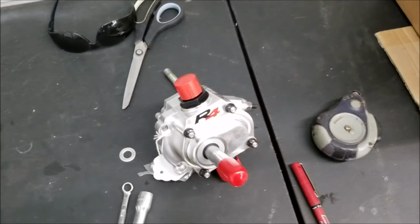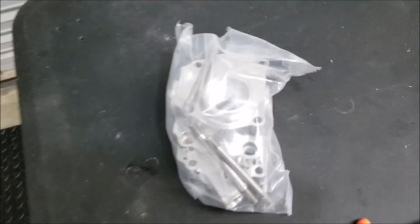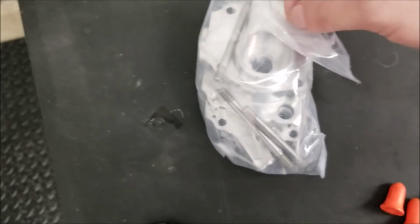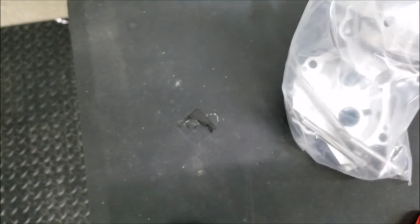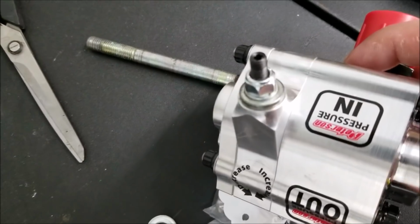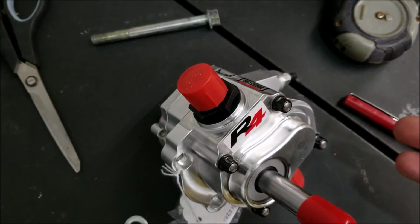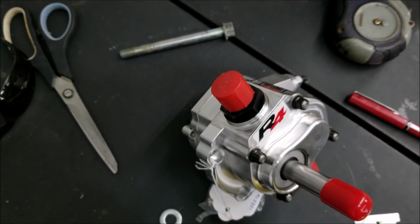Now, the reason I know that the pump was working really hard is because the last pump right here, this is the old body from the last pump, was going balls to the wall to deliver the pressure necessary. You had to put the bypass on the pump turned all the way in, which means this screw right here pretty much had to be knocked all the way in, which means the bypass is pretty much shut and the pump was running full blast all the time. And that was necessary in order to deliver the pressure that the engine wants.